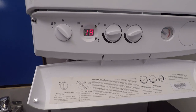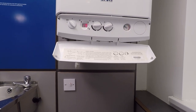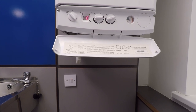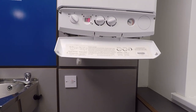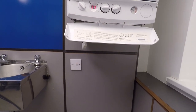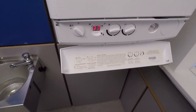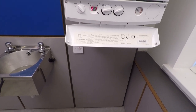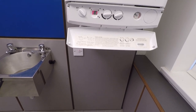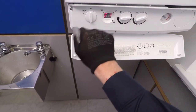Like I said, the generator is classed as a working component. In order for it to work, the circuit board needs to send voltage to it, and we can also check the resistance. I'll give it three or four attempts and it'll lock out on E133 — there it is, E133. I can knock the tap off now. I've already done my electrical safe isolation; earth continuity, short circuit, and resistance to earth are all good, and I've also checked the polarity.